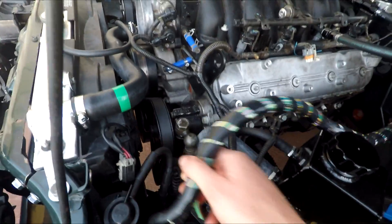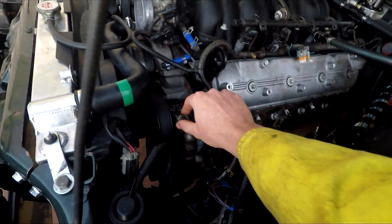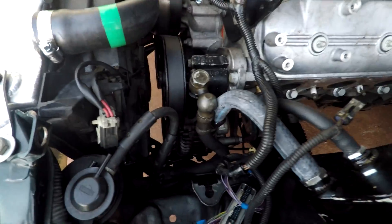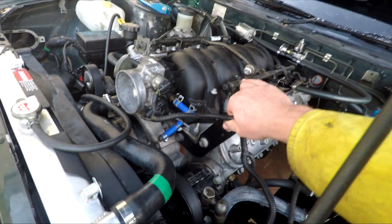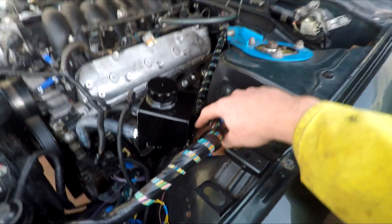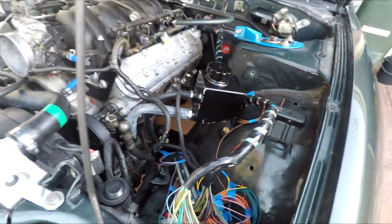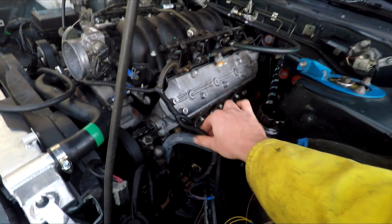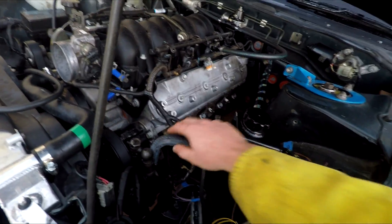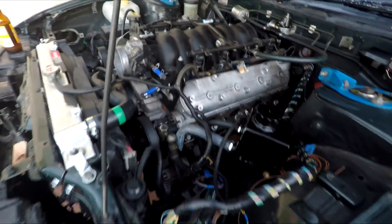The standard power steering line fits - the banjo bolt was the same thread. There is a bit of a twist in the hose but it fits fine. The power steering reservoir hits the bonnet if mounted in its usual position, so I've cut it down and remade the bracket, bent it and bolted it to the fender/wheel arch. I need to get a proper curved hose because this one has a bit of a kink. It's heater hose at the moment so it will go hard with power steering fluid over time. The return hose just goes down with the lines bent as shown.